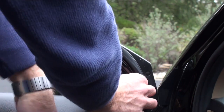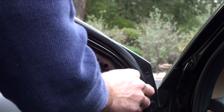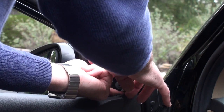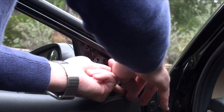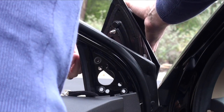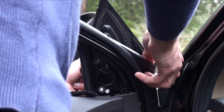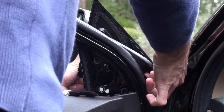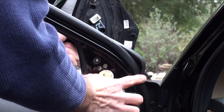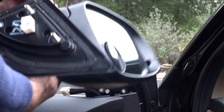I'm using two hands here — I don't really care if the mirror falls off since I'm recycling it, but I do want to keep that nut from falling in. There we go — got the nut out without dropping it. There's also a little plug on the back that holds it to part of the door; just carefully pop it out. You'll need to snap it back in later. Got it off — that didn't take very long.